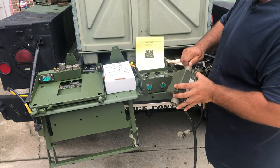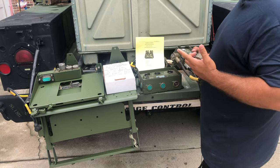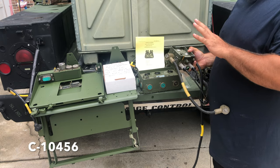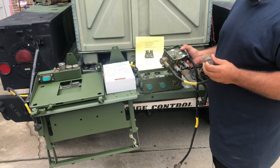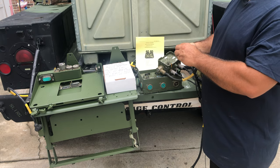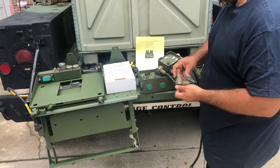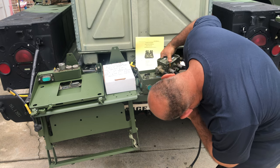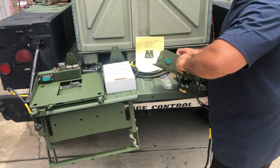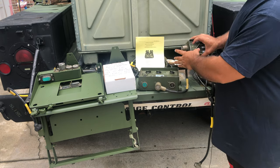You can't plug it in incorrectly — it won't allow you to. The crew box number is the C-10456, and that's the particular crew box shown here. There are different kinds out there, but the C-10456 is the one I'm using. Get your audio cable connected to your crew box — it always helps to have a flathead screwdriver to get the tabs open. Line it up with your 1780 and screw it in, and now you've got your amp connected to your crew box.